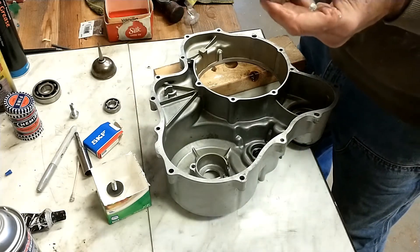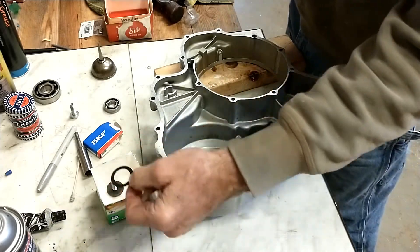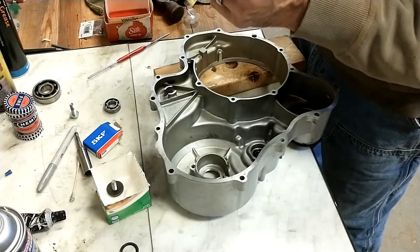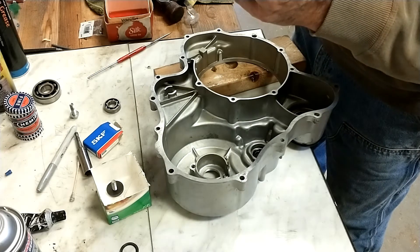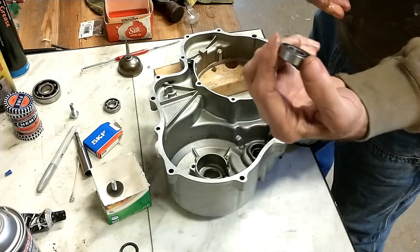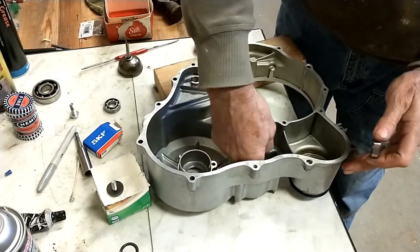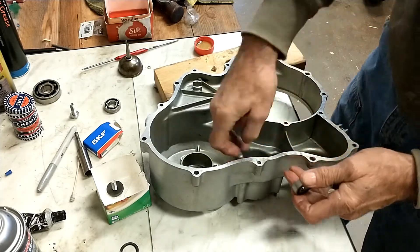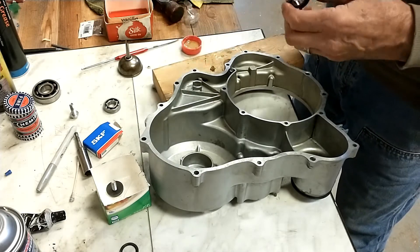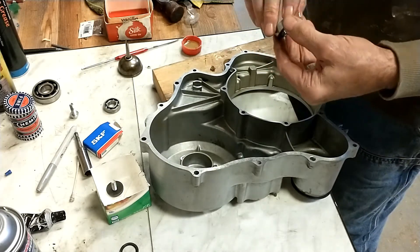I'm removing the rubber seal from the side facing the engine. The rubber seal was damaged in taking it out. The bearing has grease in it — supposedly permanently greased from the factory — but it's going to be running in oil, so I'm adding a little oil to it. I'm leaving the other seal in, facing outside the engine. There's already a seal in the case, so this will be double-sealed. It'll still get plenty of oil from the engine, and we have good insurance against leaks with both the grease seal on the bearing and the oil seal in the case.